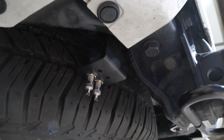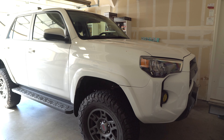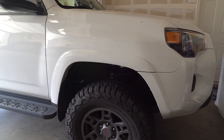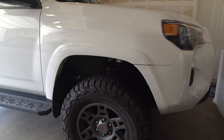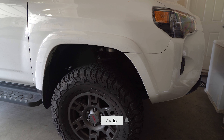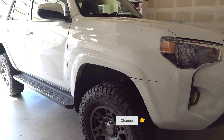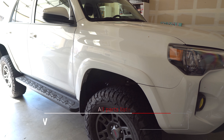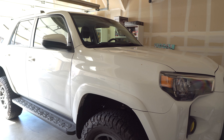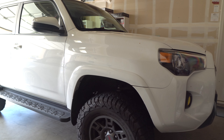These are the new RCC 2.0 HD springs with the airbag. The airbag has a little section implemented so we can pump air into the bags if needed. Once I get the new Bilstein setup in the front it will probably level things off. The ride quality in the back is perfect — it actually rides way better than the front. The front has been squeaking a bit, which still needs to be addressed, and I think that will be fixed with a new setup up front. I'll drop all the parts in the description below. If you have any questions, drop them in the comments and I'll see you in the next video.